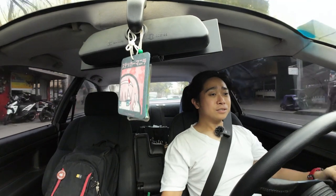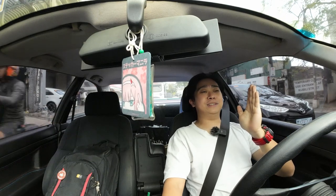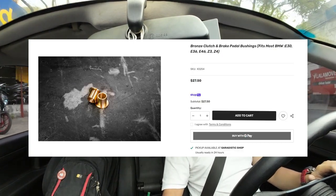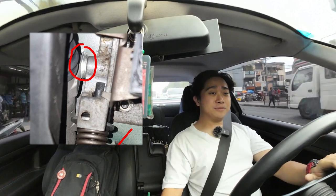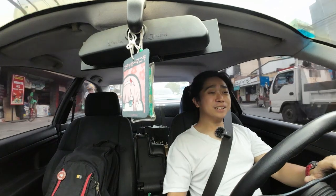Because of the added preload on the spring, the pedal now has a lot of preloaded force on it. We also upgraded the pedal bushing to the Giugiaro brass bushing, then I noticed the clutch master wasn't aligned so we aligned it with washers as well. Moral of the story: washers are great.